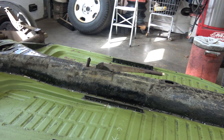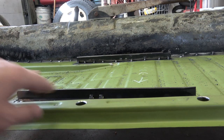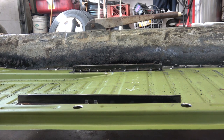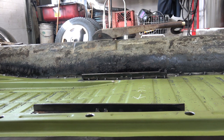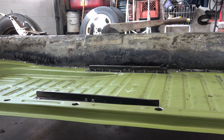So '55 and earlier beetle — if you take a look at the rails here, they go straight. There's no angle on them. '56 and later they went to the angled seat rail. So if you have these rails and you don't have early seat frames and you want to put later seats on your earlier pan, they just don't work right. You could put the seat on, but once you sit in it you can tell something is off. If you get a later seat frame from '56 and later or a '60s beetle and throw them on these flat rails...